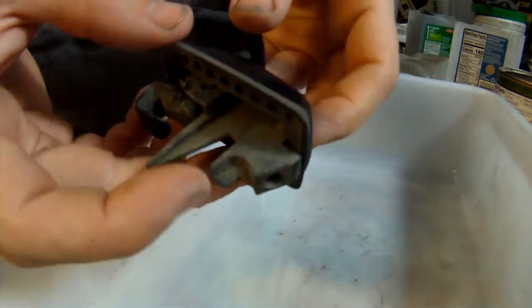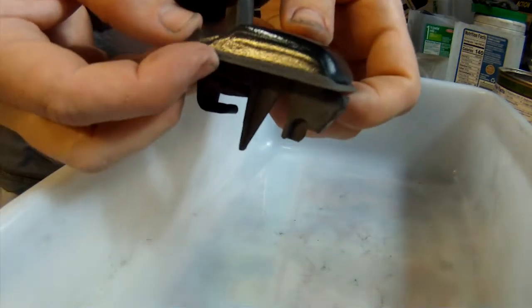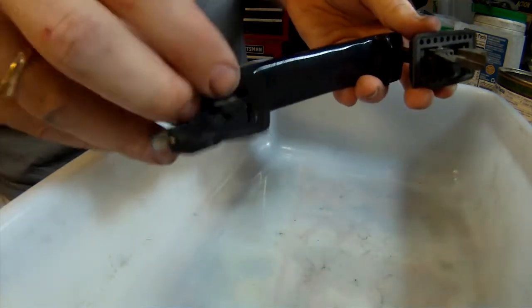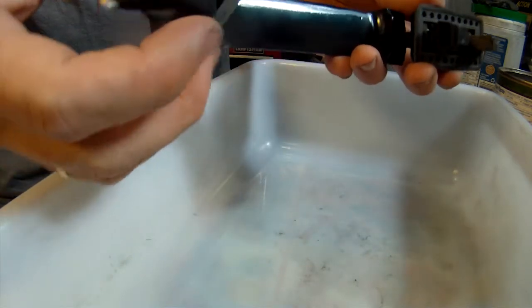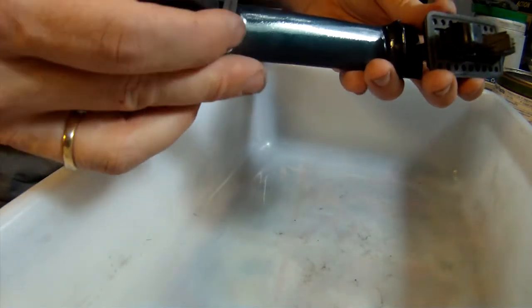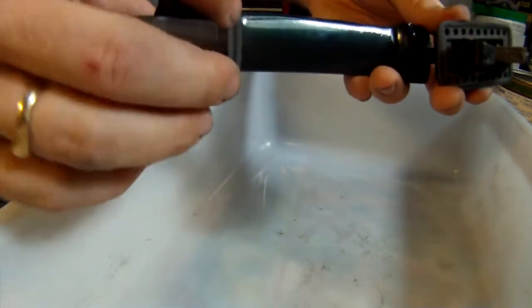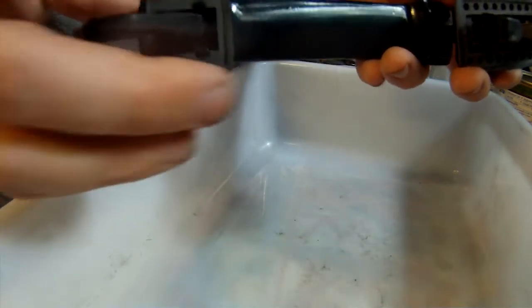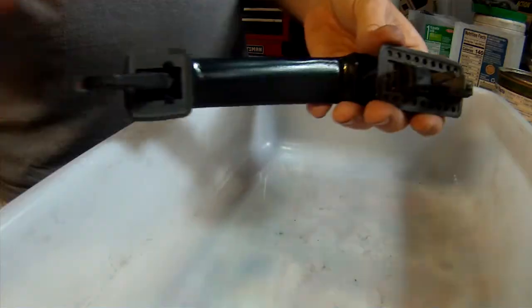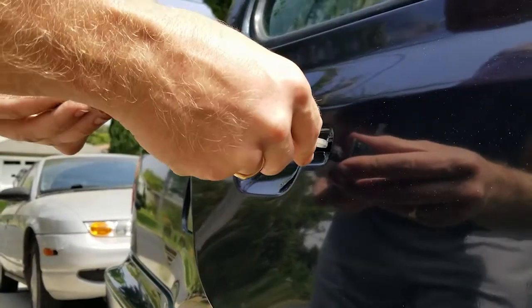My new design of the seats perfectly snapped into the cavities of the existing door handle. This is extra nice because I didn't want to be fiddling with the seats as I mounted them. The snaps keep it exactly centered in elevation and centered front to back. Also, the front seats have a similar retainer slot that uses the existing door handle nibs to ensure that the part also resides in the center-most orientation. I attached all the seats to each door handle. All the handles are the same except for the front driver's side, which has key hardware — my design is compatible with both non-key and key handles.